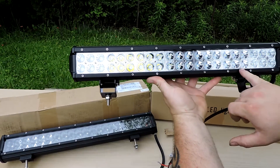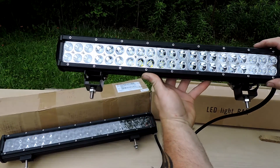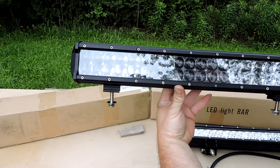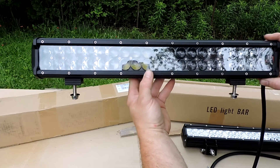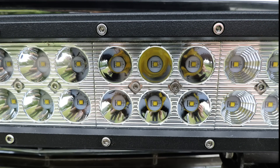You can see the spot beams in the center and the six on the outsides are flood beams. You'll notice a big difference between the Cree reflectors and the fisheye reflectors on the Osram light. I took a couple pictures to show a closer look at the different style lenses. On the Cree, it just uses a regular cone-style reflector like you'd find on a flashlight — you can look right in and see the LEDs with the reflector around it. The ones on the far right are the flood beams, and you can see the ripple effect in the reflector that's supposed to disperse the light and give more of a flood beam effect.